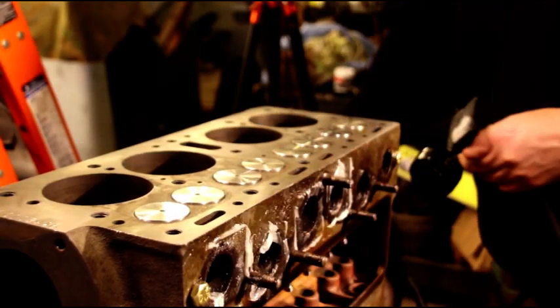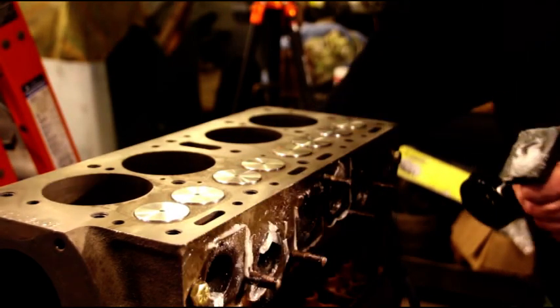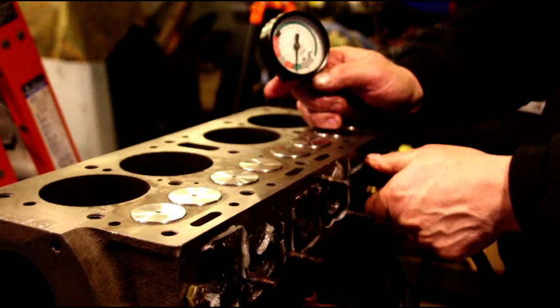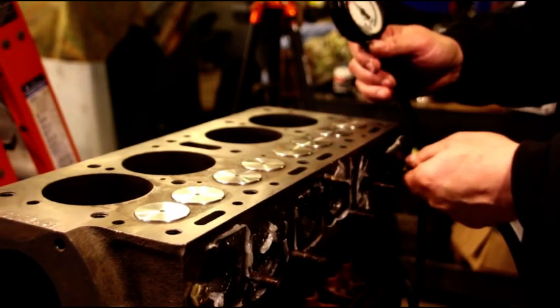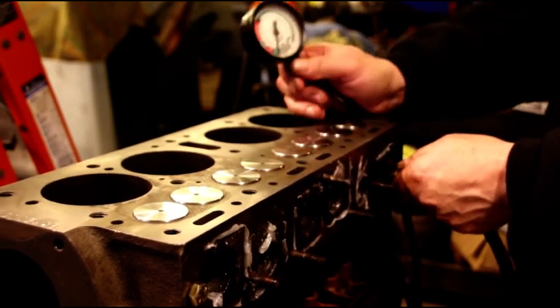It's critical that your valves are sealing like this. If they're not, you're going to be like that guy who spent $9,000 on an engine and can't get up the hill to get back to his house. There are our intakes three and four — pulling 20. And our final exhaust — pulling 20 again.